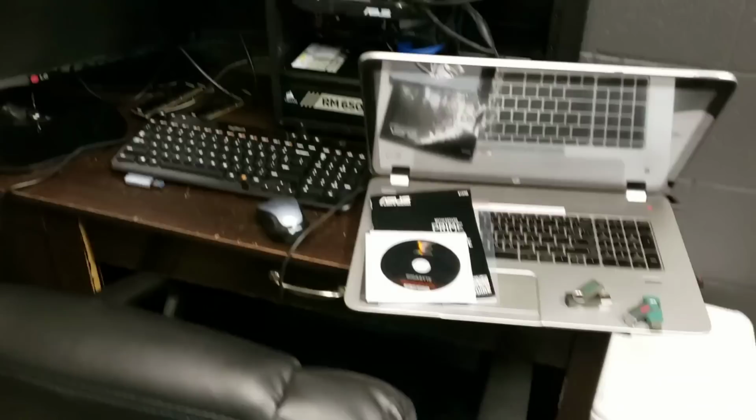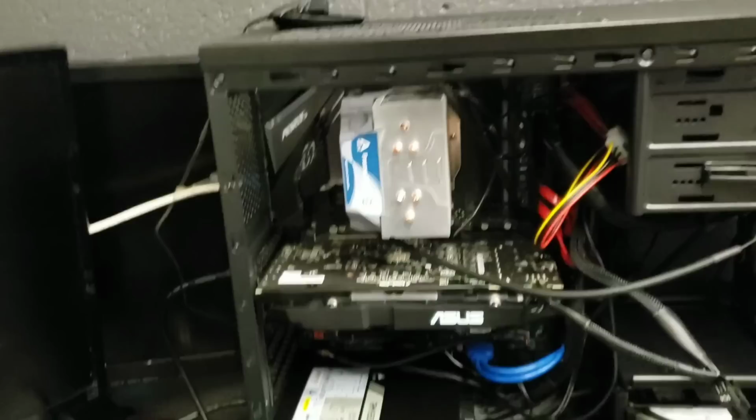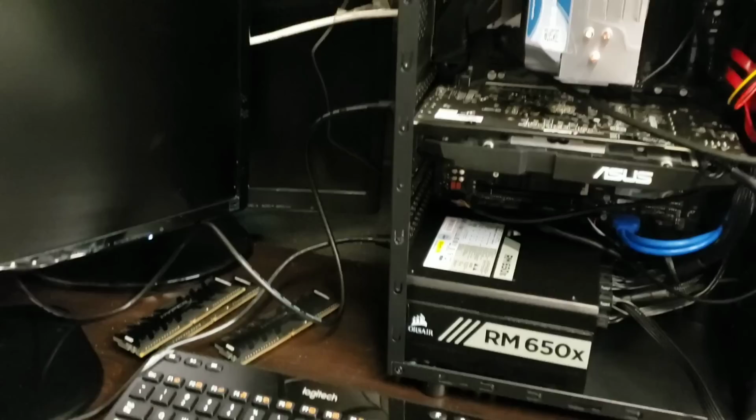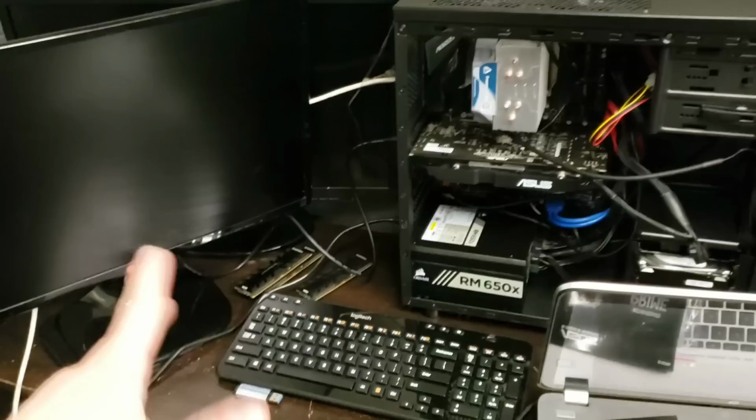So we've kind of been playing with it, trying to get it installed. And the quick update is, Sky thinks that one of these three RAM chipset thingies is bad. It did have four 8 gigs, I think? I can't remember what she got, 16 or 32. Anyway, something's not right, because it will start loading Windows with only one RAM stick in it. So I'm not sure what we've got to figure out, but that's the update on that.